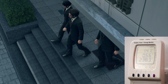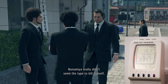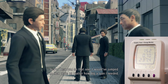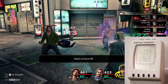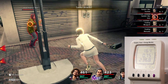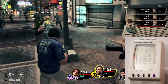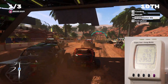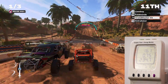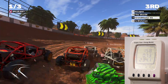Yakuza: Like a Dragon in its 1440p 60 normal mode first — just 140 to 160 watts, with a peak of around 172, bringing it more closely into line with the power profile of Xbox One X but still generally lower. You can probably imagine, therefore, that heat output from the machine should be broadly similar, if not a bit lower. Codemasters' Dirt 5 seems to have a higher overall power requirement, mostly in the 160-watt territory, but it can spike to over 170 watts.